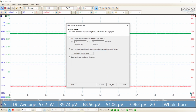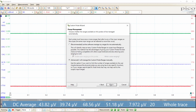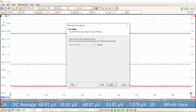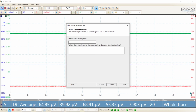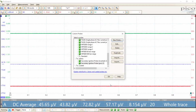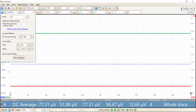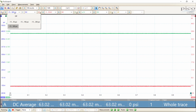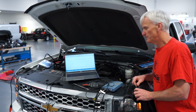Then hit OK. Next. I like to select the advanced to set up ranges. Then I'll tell it to auto-generate the ranges. And these are all pretty good. If I didn't want one of those, I could delete it, or I can create a new range, but it's pretty simple. So I'll just go ahead and say next. If I wanted to put filtering on, I could, but I'm not going to. I'll do that at the end if I have to. Then the name for the probe, I'll just say PV350. Finish, and it shows up in my library right there. So now if I hit OK, go to my channel A, under probes, under library, you can see PV350. And I can set whatever range I want. I'll go ahead and set the -15 to 200 PSI range. So now I'll go ahead and start this up and we'll see how well it does.